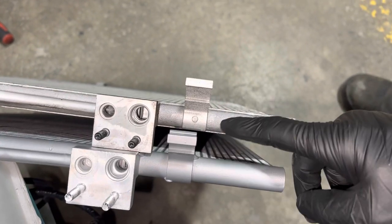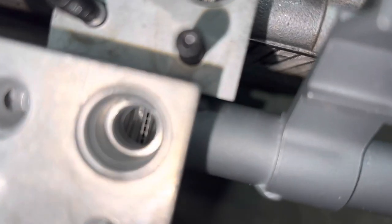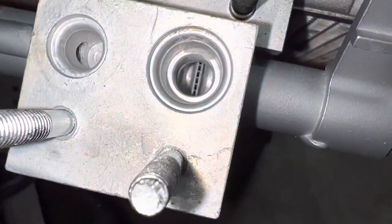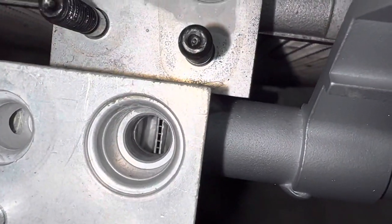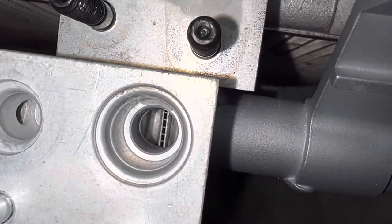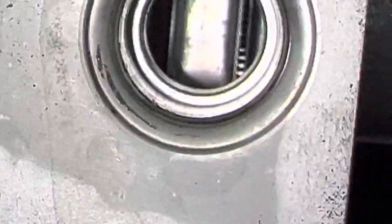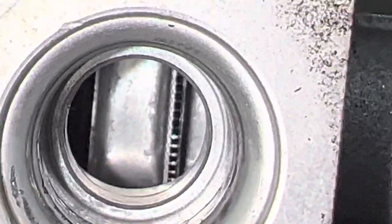Here's the difference between an aftermarket and an OEM. Let's look inside — you see those tubes in there, you see that flat plate, and you see the size of those little openings? Smaller is better with more fins, it's more surface area. Let's zoom down in there — that's aftermarket. Now let's go to OEM.